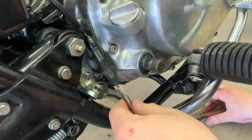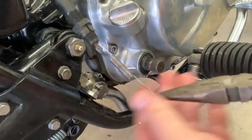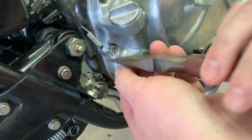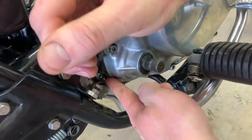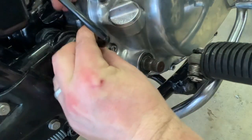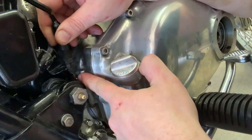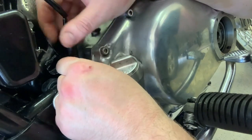That one's tricky — it's going to be a little fishing expedition. Hook it up on the bottom first, and then what we can do is pull the switch up into its bracket. I'm going to try and grab it with my needle nose kind of high on the spring. Luckily we do have a little bit of play, so maybe hold that at 45 degrees and give that a push on there just like that.